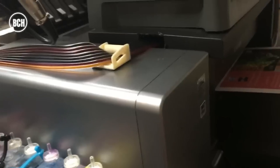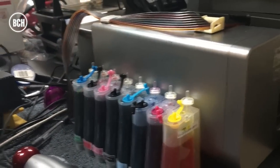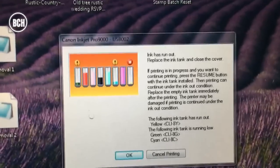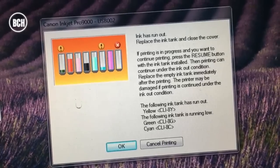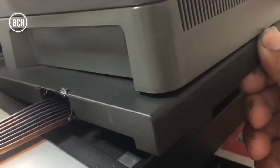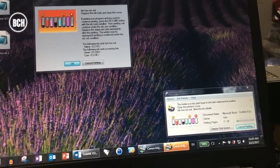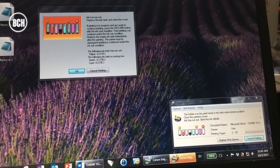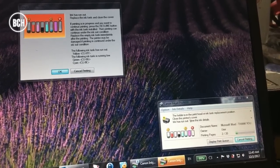The last step is to reset the ink levels. After a couple hundred pages, the printer will display that the ink has run out. Do not close this window; just open and close the printer lid, and the ink level will be reset automatically. You might notice we cut off a piece of plastic from the cover because we're going to put something heavy on top. The chip will reset only on depletion. The yellow one, which is far right, is depleted and has a red cross on top of the cartridge. The two showing low ink level will not reset because they haven't run out yet.